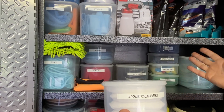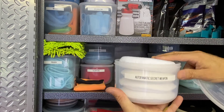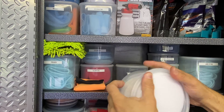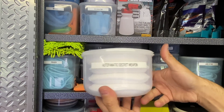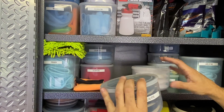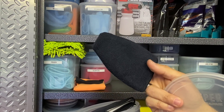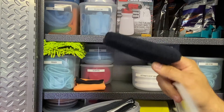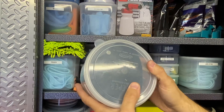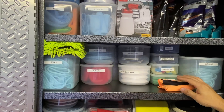The larger PFM drying towel sometimes hits the pavement when twisting on low cars, so I only use those on SUVs or larger vehicles. Over here are the Griot's Garage Dual Weave Wax Removal towels - absolutely the best. A note: if you're using Soft 99 Fusso Coat with solvent, chuck these towels after - don't put them in your washing machine. They're great for Collinite 915 and any other wax - reduces hazing and marring, especially on dark colored cars.